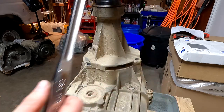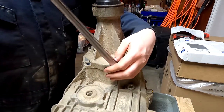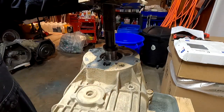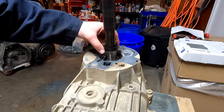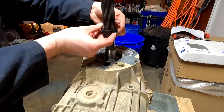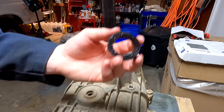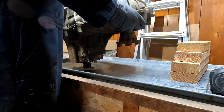I told you that was going to happen eventually. All right, now we just pull off our extension housing and set that aside. Now what we're going to do is take this rubber washer and sneak it over top of these splines here - we're going to want to hold on to this guy. The kit doesn't come with one of these and we don't need to replace it, it's perfectly good. All right, now we've got that rear extension housing off.